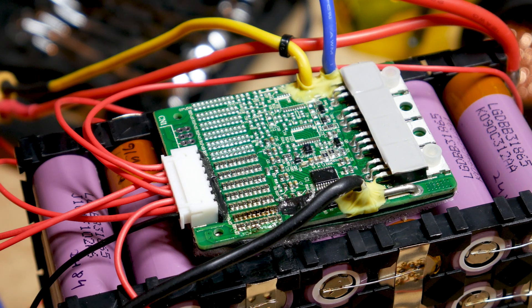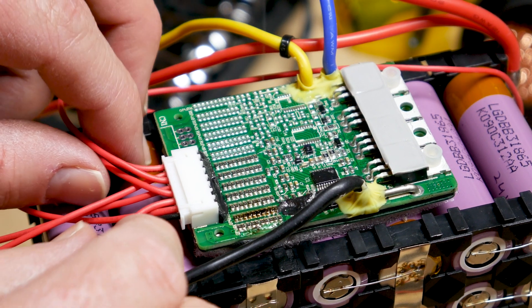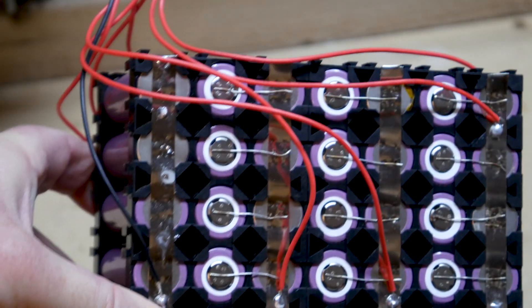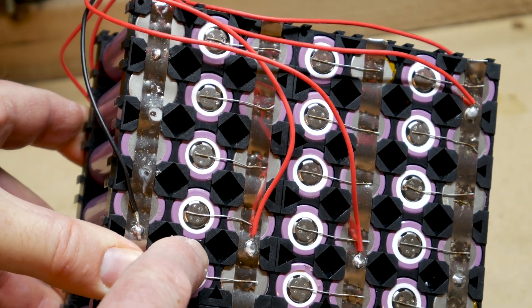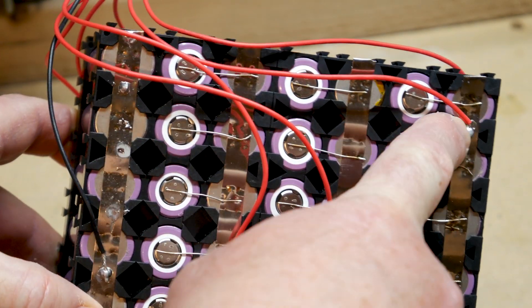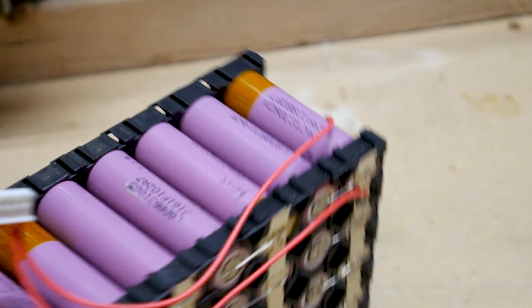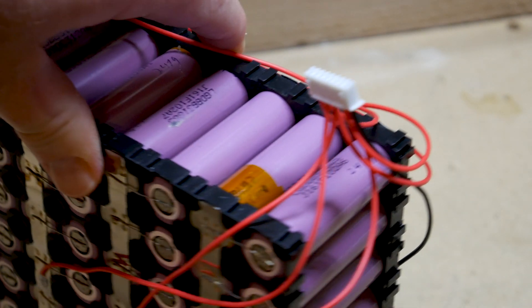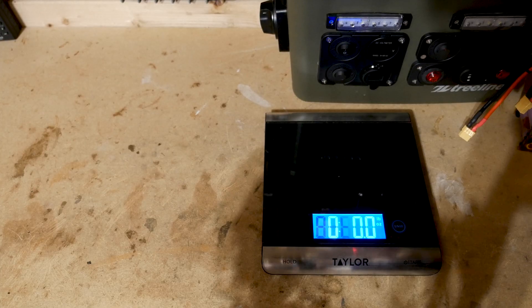This battery has actually been sitting on the shelf for several months. I had a previous video on my channel where I showed the smoking BMS when I was putting together this battery pack — that was because I had a couple wires crossed on my balance leads. I've gone ahead and fixed that, a new BMS has been installed, and the wires are all now in the correct order. I've been waiting on installing this battery because I wanted to use the Vruzend Kit battery on another project. That project is just about ready to go, so I want to go ahead and switch out these batteries and install this new 7S 10P 25 amp hour battery.